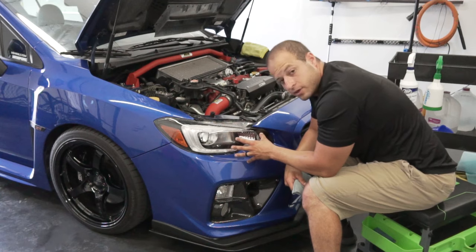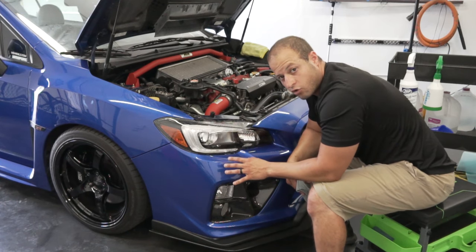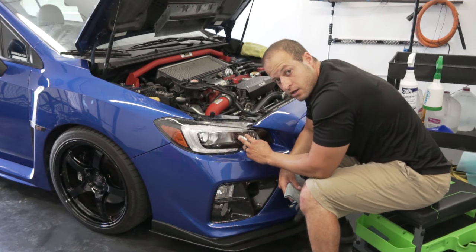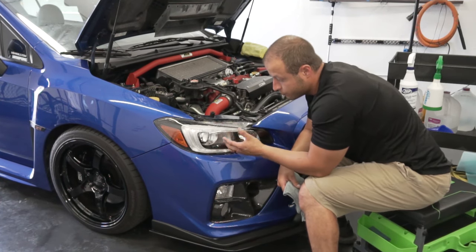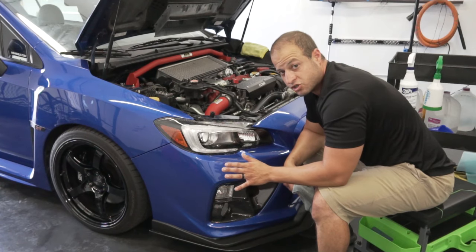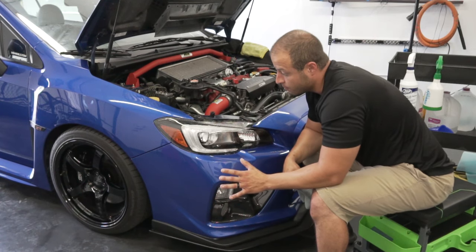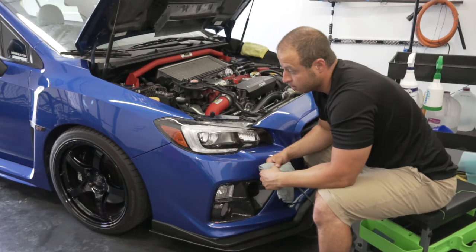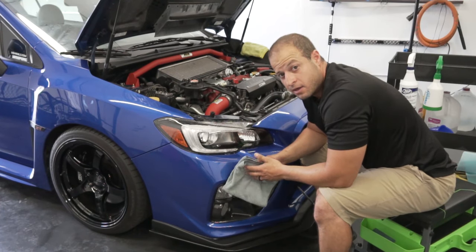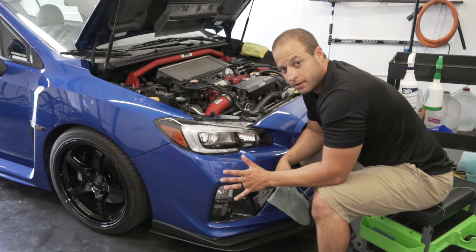Another thing to remember: if you have liquid inside, it's okay — you just don't want to have an excessive amount. The liquid will eventually dry out over the next couple of days up to a week. If you have any discoloring, that will all go away. If you lay it down and push it and then lift it up, you're probably going to have a bigger issue. You really don't want to pull the film up unless you really have to. The only time you can pull it up is if you haven't tacked it yet. Remember 30 seconds is about your play time — if you leave it on the car more than 30 seconds, you have to re-lift it and re-wet the area and the film. That will make for a much cleaner install.